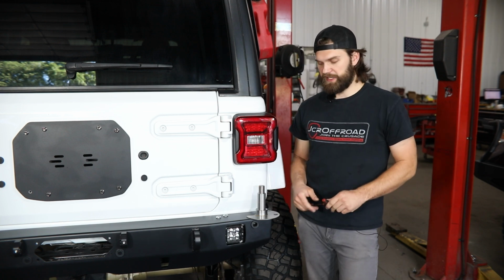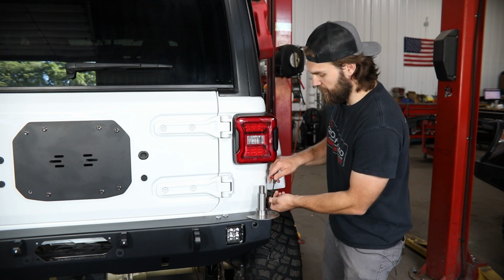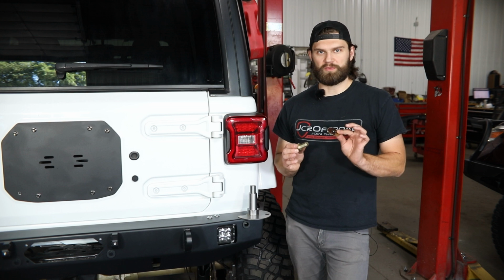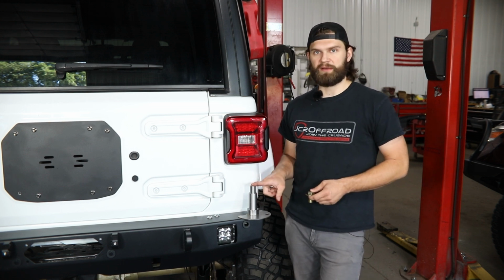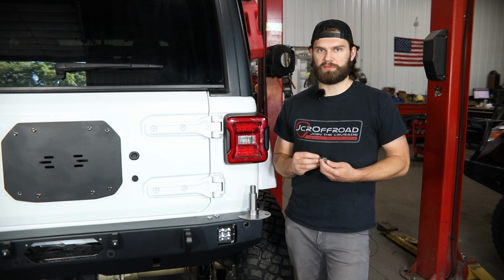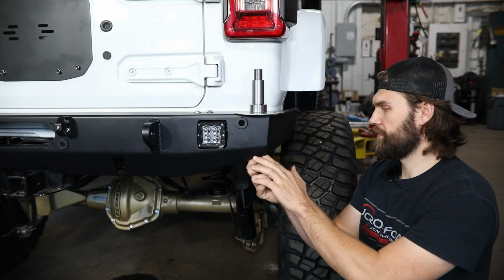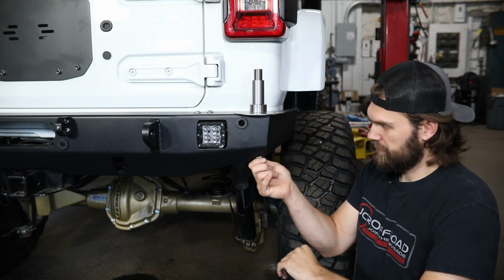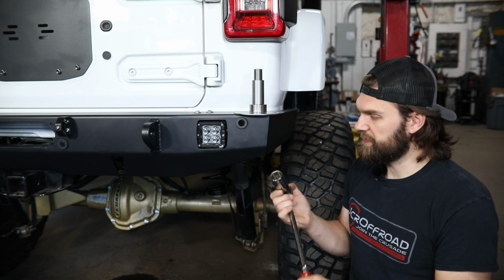Once you have that down in place, grab a 5/32 hex and tighten up these pin track mounting bolts. Next, you can grab the large yellow zinc bolt as well as washer from your hardware pack. That's going to install into the bottom of this spindle sleeve. Now again, right here, you're going to want to lubricate this with some thread lubricant before putting it in to prevent it from seizing over time. Once you have that started, you'll need an 1 1/8" socket to tighten that up.